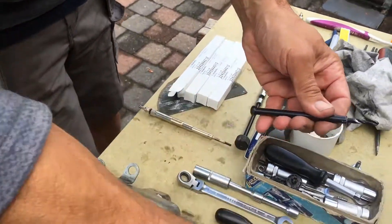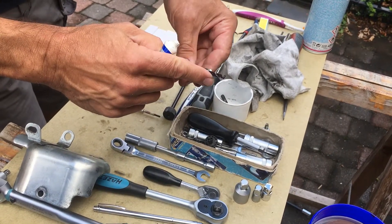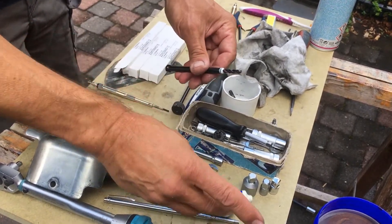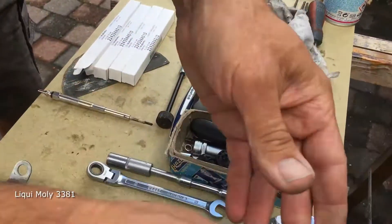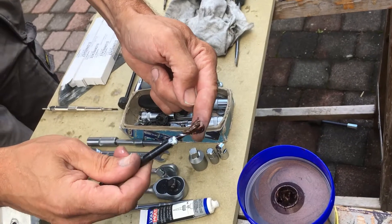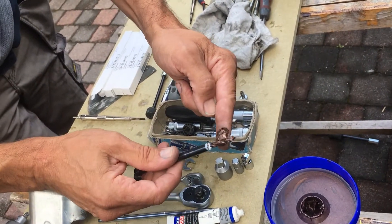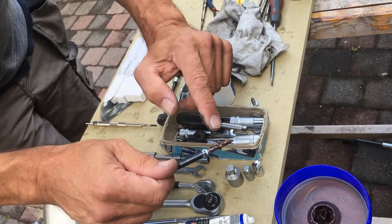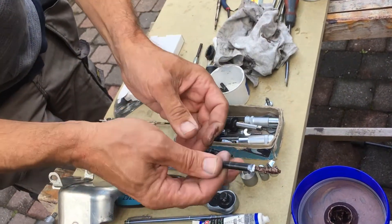First of all, I put a little bit of special grease on the reamer itself, so the result of the cleaning will be shown by the amount of grease taken away. I fill this section of the reamer with copper grease so that any carbon debris induced by the cleaning process will be captured by the grease and will not fall into the engine or cylinder.